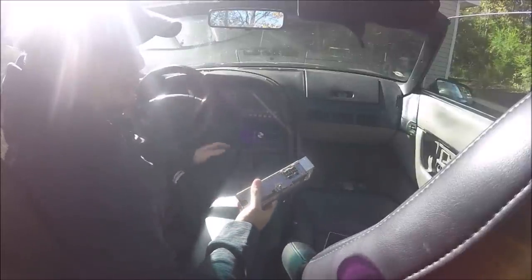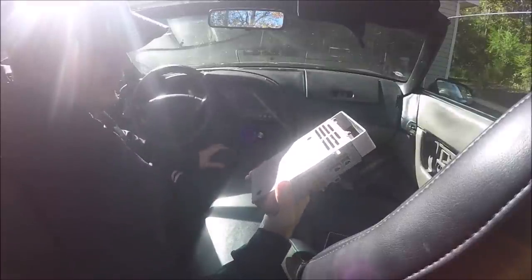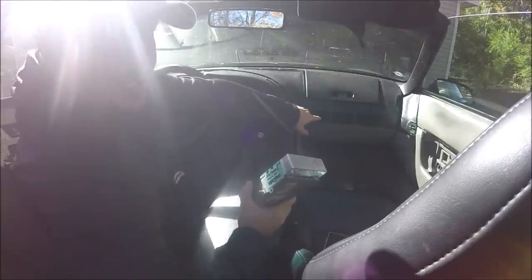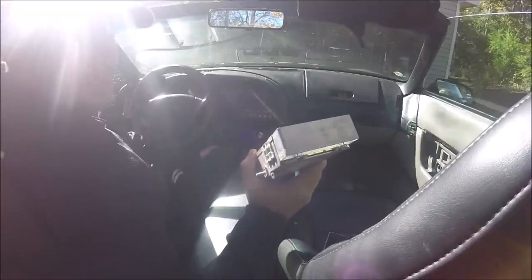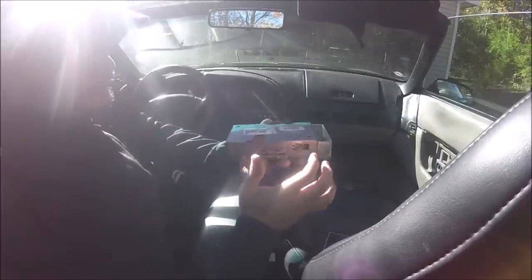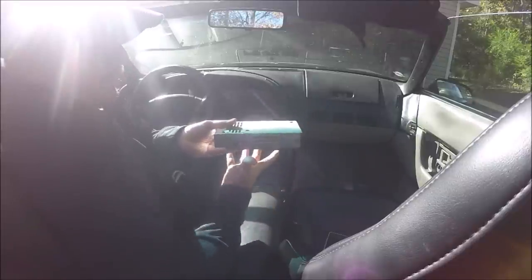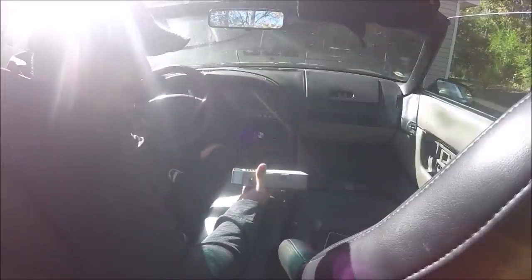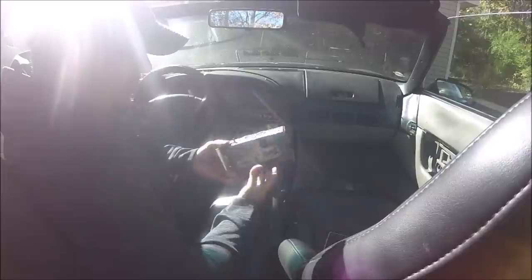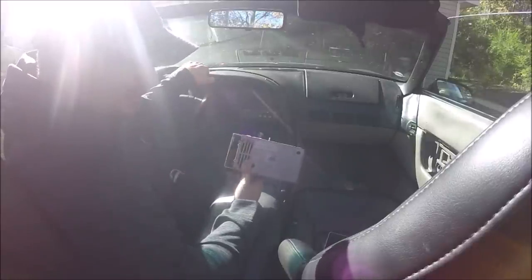At that point the Bose system is essentially disconnected and you can kind of leave it at that. I went ahead and took the CDM unit out from underneath the dash — I just didn't want it in the car anymore. This is the CDM unit under a piece of dash on the 91 model, and it's underneath the storage compartments on later models. It's a pain to get to. There are connectors on both sides, and this is also where your antenna connector comes in. Once you disconnect all that and remove it, you have to take some interior panels off on the side and drop the kick panel to get to it. If you're big, you'll need to take the seat out. But you don't have to remove this to do the upgrade — I just didn't want it in the car and was planning to run an antenna extension.